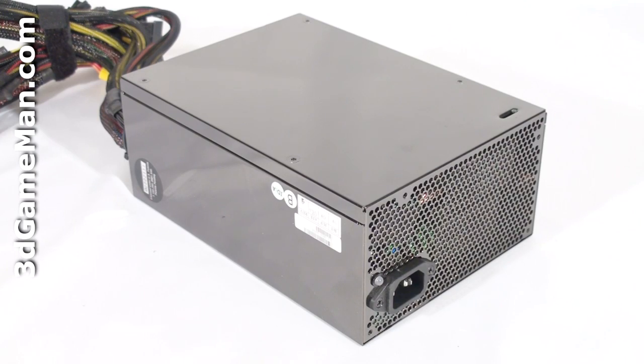There are a couple of important things to remember when selecting a power supply. The first is wattage — determine how much wattage you require based on the hardware you'll be installing. Generally speaking, a medium to high-end gaming rig would require a 500 to 700 watt power supply. For a hardcore system, select around 800 watts. If you're building an extreme gaming rig with a top-of-the-line multiple video card setup with lots of other hardware, get a power supply that's 1000 watts or greater.